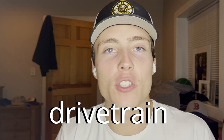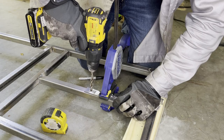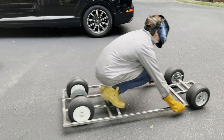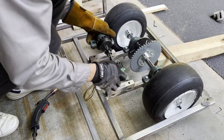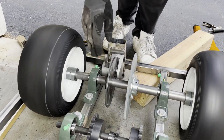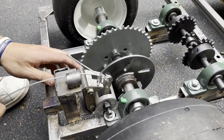Now it's time to build the drivetrain system, starting with the main axle. Most of these are basic go-kart parts picked up online. I picked a sprocket that would fit under the couch with enough ground clearance, then designed the jackshaft to get the correct gearing ratio. The jackshaft reduces the RPMs of the wheels and increases the torque, because this thing's not going to be easy to move with three guys on it. I then welded on the brake, which gets activated by pulling a small lever — and I added pieces to allow braking via a metal wire while driving.